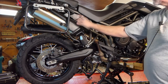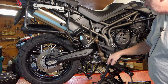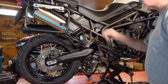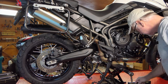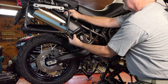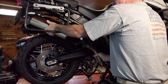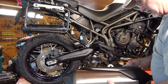The first thing we need to do is get this muffler off. The lower control arm kind of wraps around it back here and it won't come off with this pipe in the way. We've got a hanger up here and then just a sleeve with a lead gasket that this pipe slips into, so we'll loosen this up and take this hanger off. Hopefully I can do it without removing the luggage racks. Yes, that will come off without removing the rack mount.